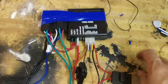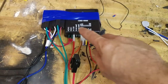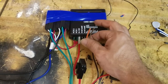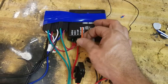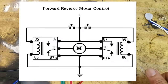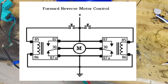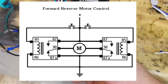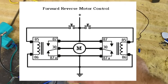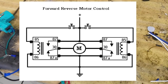I have the receiver wired up with the relays attached to it. Channels one and two will be lock and unlock. This kit has four channels, so I'm going to leave a little extra wire on three and four in case I want to come back later with a trunk release or anything else. I've got my grounds, my wire for positive off the battery, and then my trigger wires coming up to channels one and two.